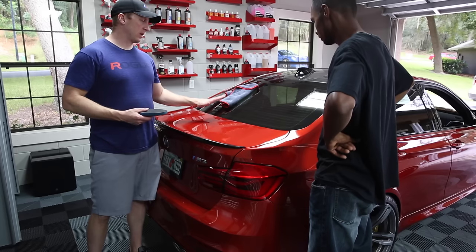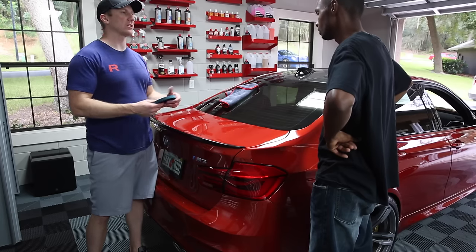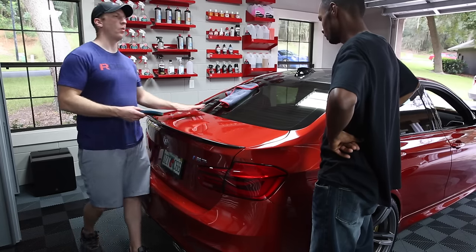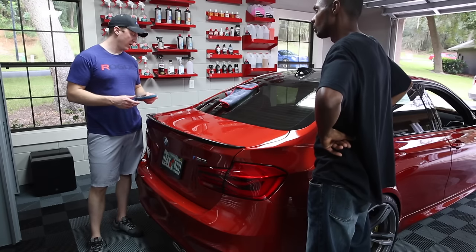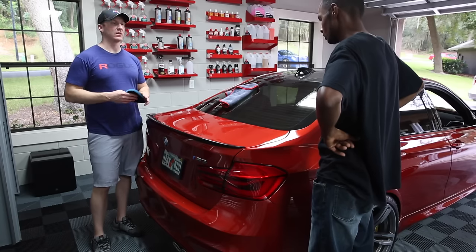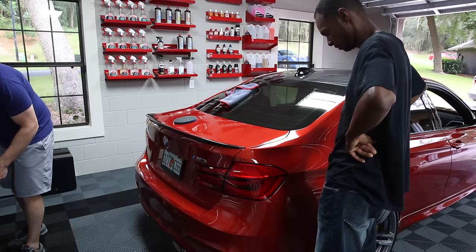So we got the paint clean. Let's pretend like we theoretically stripped it. This is gonna strip off whatever wax is on there too. The clay bar will pull the wax off as well. We're going to wipe it down with alcohol to make sure we get this stuff stripped off. But normally this would be bare metal right now with no protectant on it. So we'll use polishers.